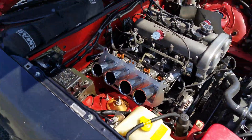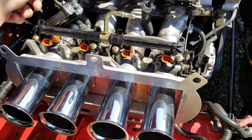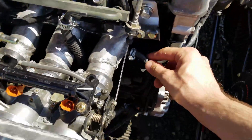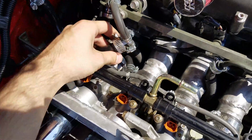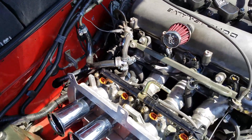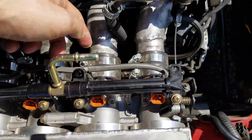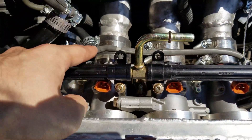There are also some vacuum lines you've got to run. There's a vacuum line that goes to the brake booster, a vacuum line that goes to the fuel pressure regulator, and a vacuum line that goes to the manifold absolute pressure sensor. The vacuum line for the brake booster and fuel pressure regulator is just teed off of this front intake runner — there's a little intake port — and I ran it all the way to the back of the intake manifold with a vacuum tee that tees off into the regulator and then into the brake booster vacuum line. The MAP vacuum line is right here since the GSX-R ITBs come with a port for all of the ITBs to give you a vacuum signal.